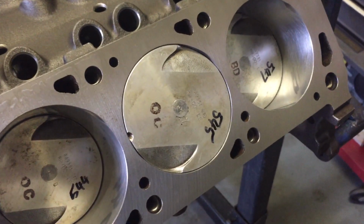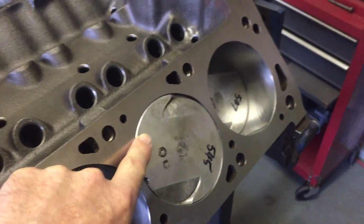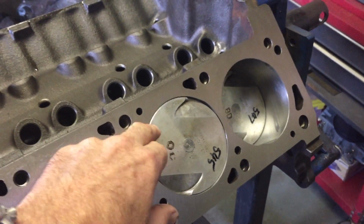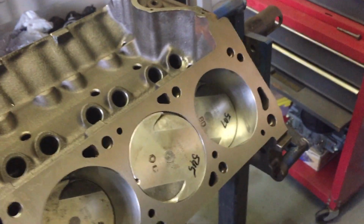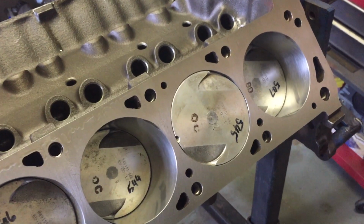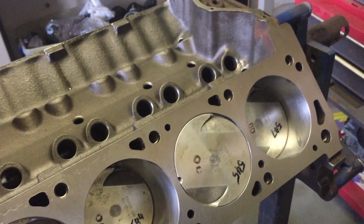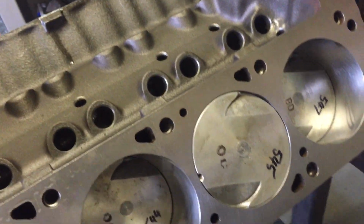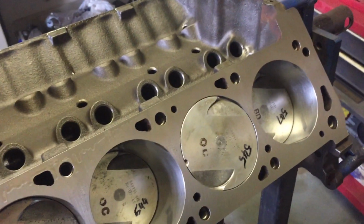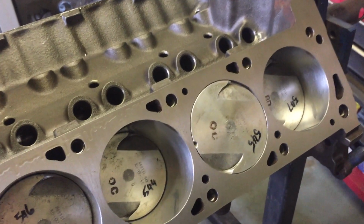So Ford back then, whether or not they realized it, were producing a sort of development in the area of combustion process that was ahead of its time. I'm guessing that all they wanted to do was increase compression. They didn't realize that what they were doing was improving the combustion process as well by creating an almost perfect squish area. Now they would have been using head gaskets that were approximately 1 millimeter to 60 thousandths of an inch, like 40 thou to 60 thousandths of an inch thick. And once they're compressed, they can compress down to close to 40 or even 35 thousandths of an inch.